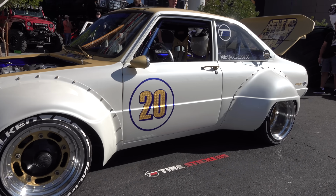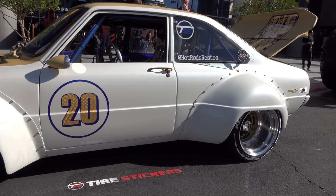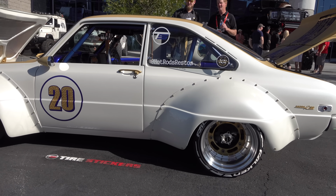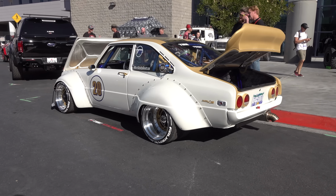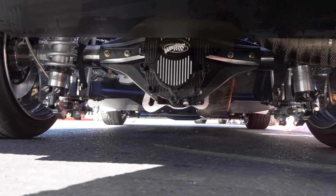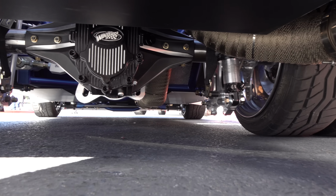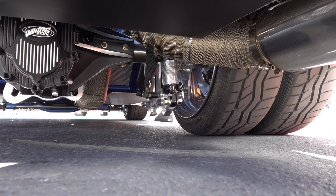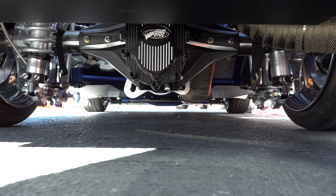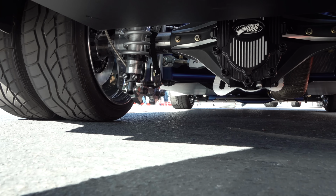Has some very unique rear wheels that house 2 tires and share the same air. It's a dually, but it's not. We call it a twin rim, because it's basically a Siamese twin wheel that shares the same air, and it gives me the footprint, the small diameter rotating mass that I was looking for in the car for the performance, and the footprint on the ground that we need to hook up the 700 horsepower.